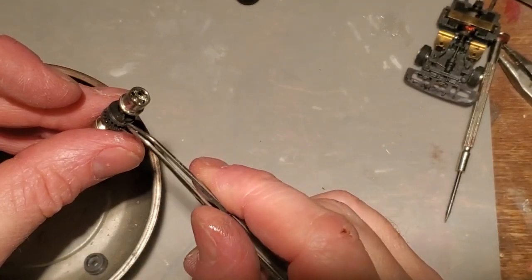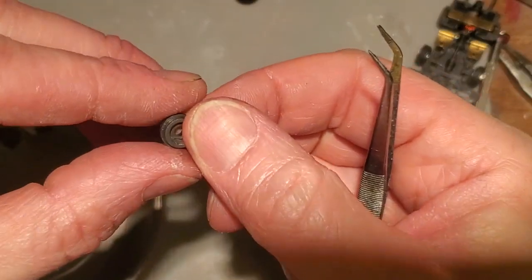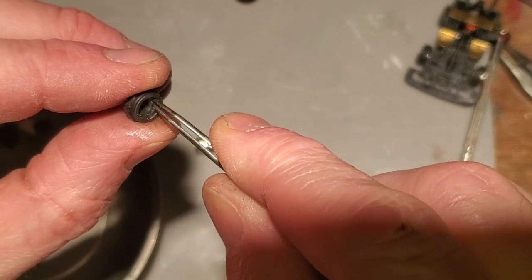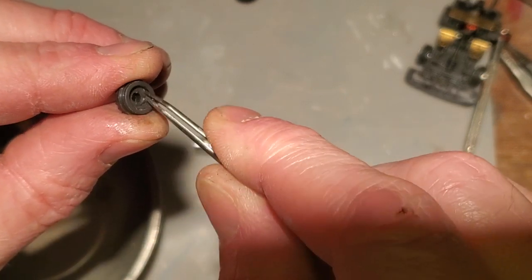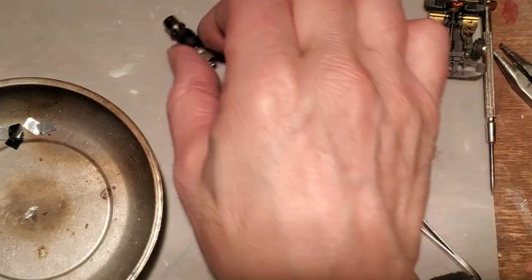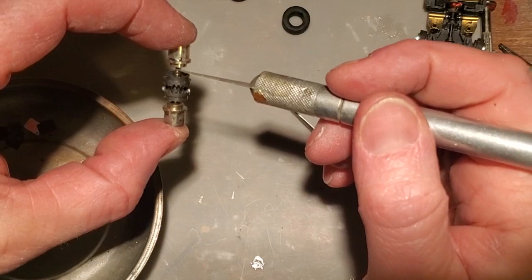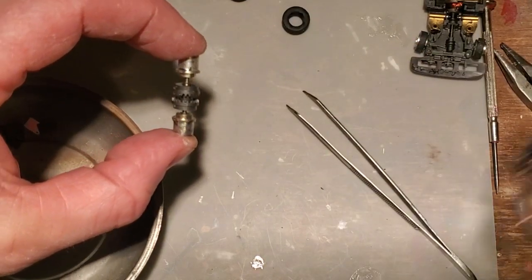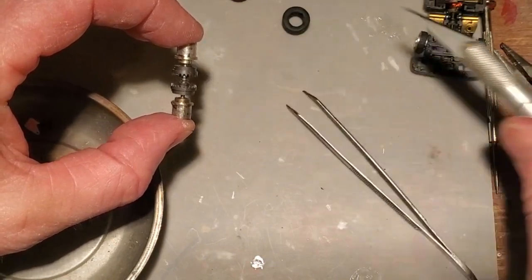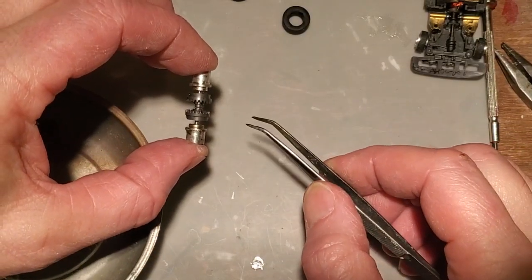And so it's now inserted in, and here's the inside of that gear. You'll see that there is a stop, and so it slides along and then stops right there on the inside of that gear, and that prevents the axle from going completely all the way around. Now, once you get this off, you're going to want to clean off all the extra hair that may have gotten wrapped around the rear axle. You may even want to take some Dawn detergent and wash that with a toothbrush.